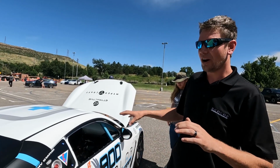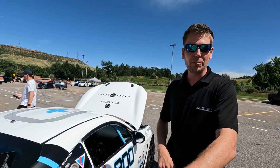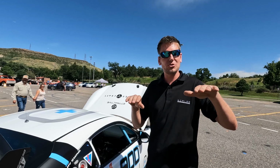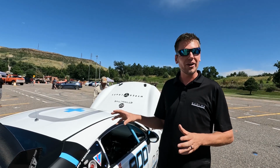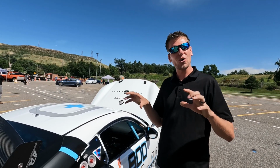So with a flat bottom car, we gave the car about 1 degree of rake, tied in with the diffuser we have at the back. So now we don't have an exhaust back there. The whole car acts like a big diffuser, and aerodynamics was super easy to set up on this car. We actually had the car at one of the best wind tunnels in North America at Ontario Tech. So we put this in the wind tunnel and tested all the aero on it.